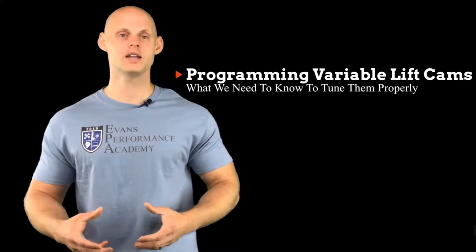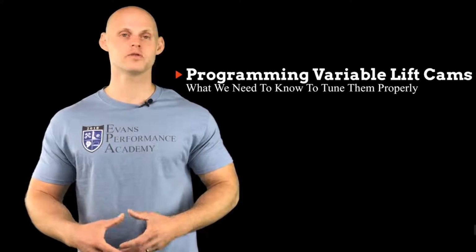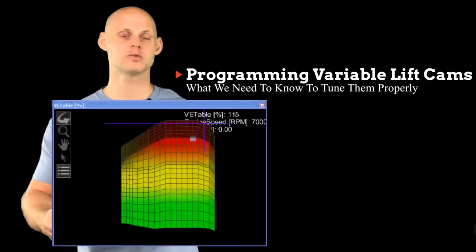So if we go ahead and just tune the low cam, we're going to find our fuel table is going to look like this. Now this represents the volumetric efficiency look of our low cam air mass model coming into our engine.